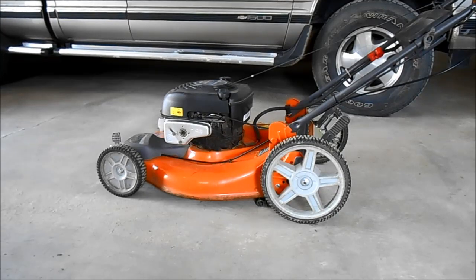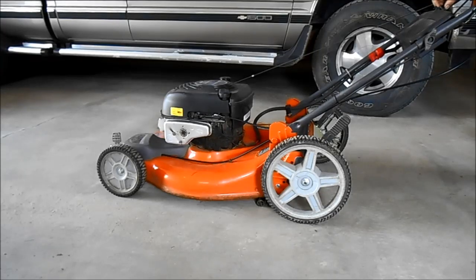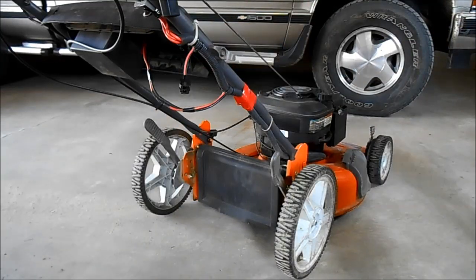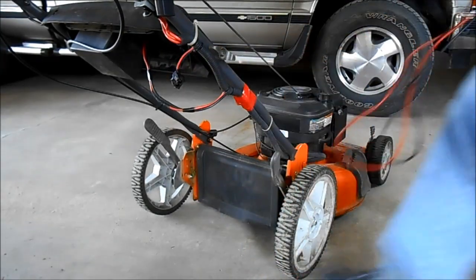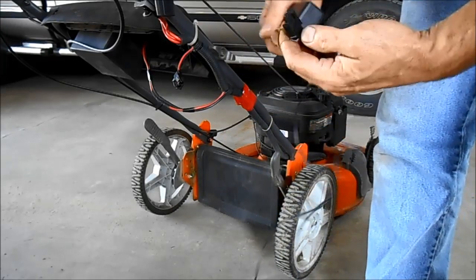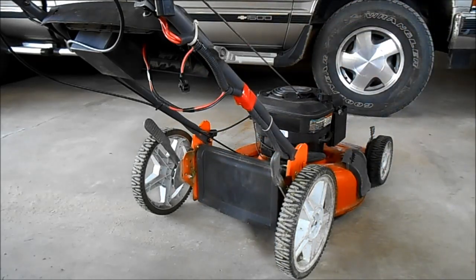Alright Tubes, small engine demo time. Primer three times — one, two, three. Close the brake — or bail, or whatever you want to call it — and I'll hit the switch. Now I'll just take a voltage on this charging cord here. Thirteen point zero five volts — there's nothing wrong with that. And the little charger that comes with it only puts out an amp; that's all you need to charge that little battery, it's not like a car. It's polarity sensitive like we showed you, and you just plug that into the wall and away we go. VTH V1, over and out.